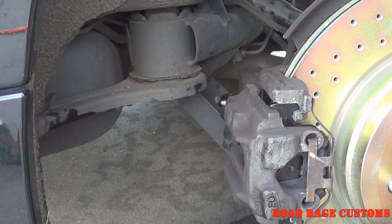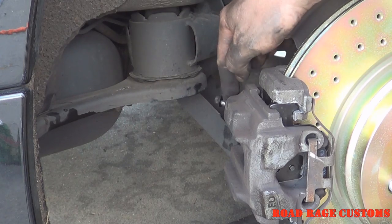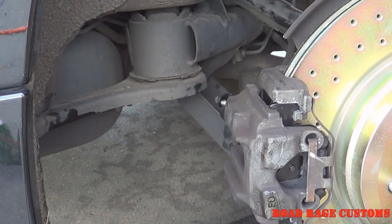Okay, this is the driver's side now — I've already got it finished. Some people prefer to open the bleeder screw before they push the caliper pistons in. I didn't on the passenger side, but I did on the driver's side. Plus my car has a light on that says it's time to change the brake fluid, so I'm going to go ahead and do that now.